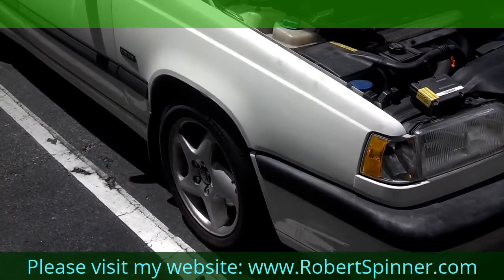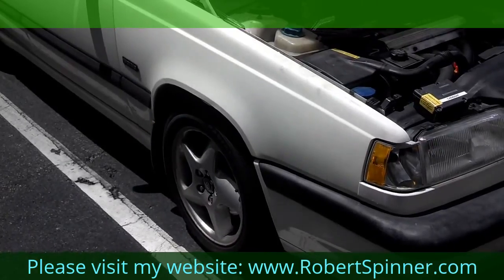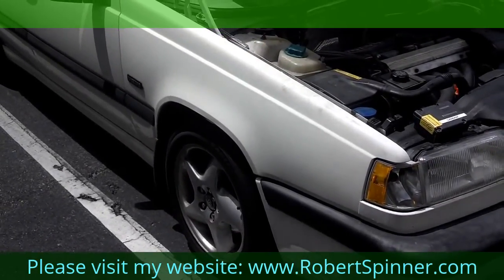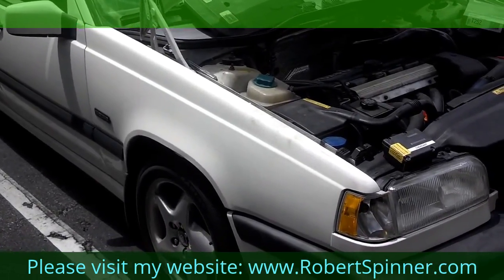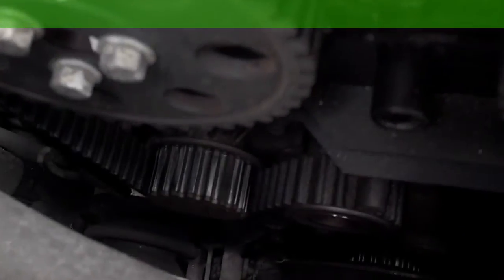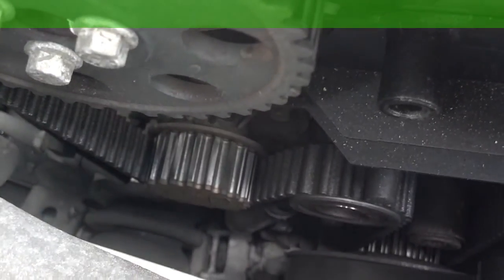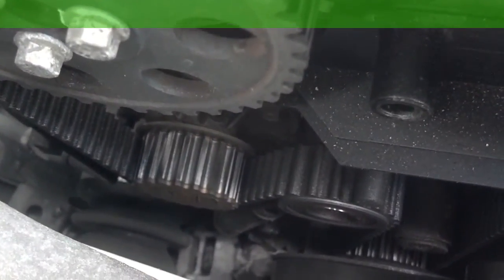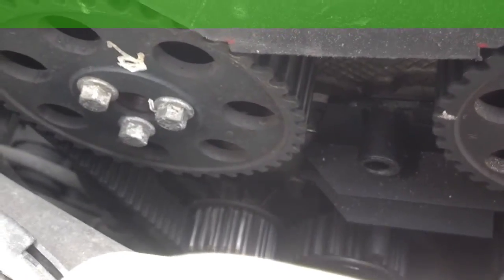Kicking off day 28, working on a 96 Volvo 850 T5 model. We're going to start off by changing the timing belt, a couple of mounts, tweaking a couple other things, and we'll just take it one step at a time. The timing belt was replaced — we're not sure the mileage ago, but probably three, maybe four years ago. The water pump's been replaced. It looks like the tensioner's been replaced and the idler, but we're just not sure how many miles on the vehicle. The mileage is not counting right.